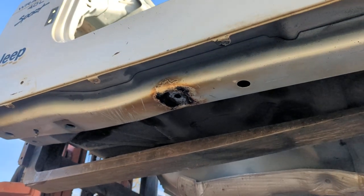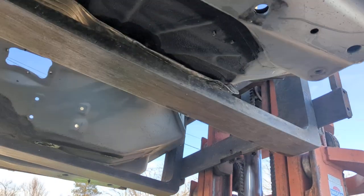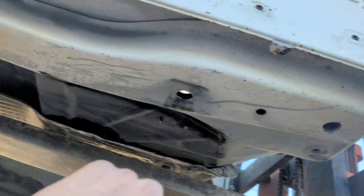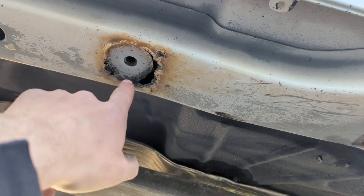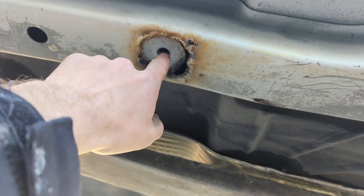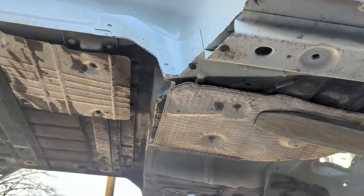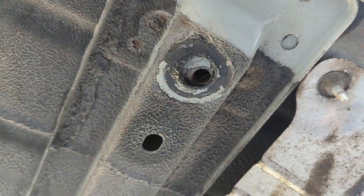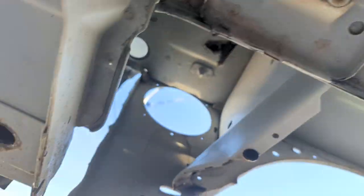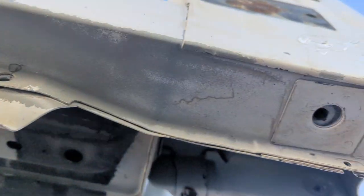This whole door pocket isn't very easy to replace; however, we do sell those. We don't sell them all that often because I have to cut a tub to do it. In cases where a tub has damage on the top side but the bottoms are good — same situation here. This one is the same: you've got a good one here, and that one is not as bad as the other side. This side is fine — it's just this side that's gone. Threads were good again, nothing broke off. The rear one — that's what makes this tub a C. Your other mounting points are in great shape.